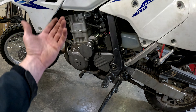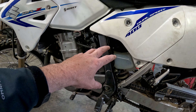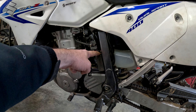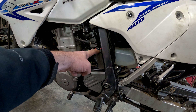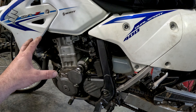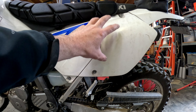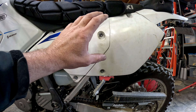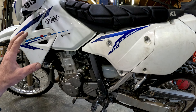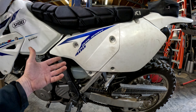I don't really know what voltage this produces — probably on the order of 30, 40 volts, something like that. Obviously that's too high for our motorcycle's electrical system, and it's AC, which we can't use here. So our regulator rectifier right here takes that higher AC voltage, rectifies it, converts it into DC voltage, and then regulates it down to about 14 volts — safe for all the components in the electrical system. Then we've got our battery. The battery is just an energy storage reservoir; it's not really being used when the motorcycle's running. The charging system takes care of all the electrical loads when the engine's running, and a little bit extra to recharge the battery, which is only used when you first start the motorcycle.